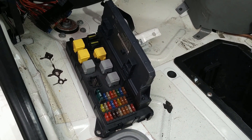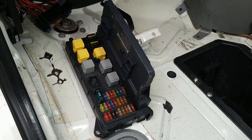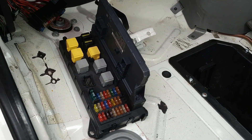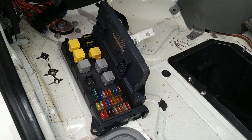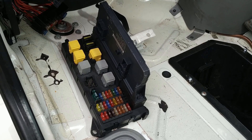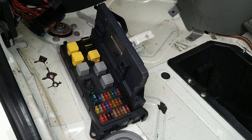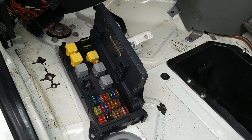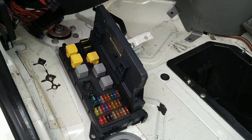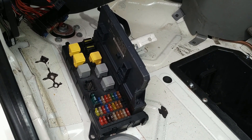D-plus in Mercedes-Volkswagen Crafter-type terms is the signal when the engine's running. On the Sprinter it's presented in the passenger seat via an interface called EK1 — I'll put a link below — which gives you a handy connection point for engine running, ignition on, and a battery supply output for connecting accessories. But in the Crafter, at least in my Crafter, I don't have that, and the only source of the D-plus signal is a blue and white wire that comes from the alternator.